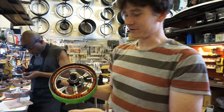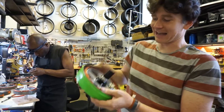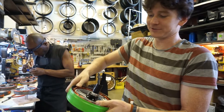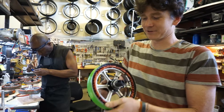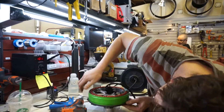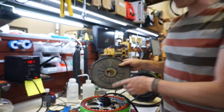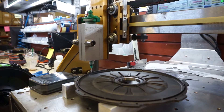The other annoyance from the side cover popping off — with that adhesive not holding — is that pulling this ring off the stator is now a very difficult challenge. I have nothing to grab onto, and the ring is ovalized by the magnetic attraction force. I don't have a 100% success rate getting these two things apart, so I may have to make a little jig to help. Boom! And it's intact — last time it just separated in two. Now we just have to seat that bearing and put sealant on the mating side cover plate so all the joints are totally sealed and we don't have any concern for stator leakage.